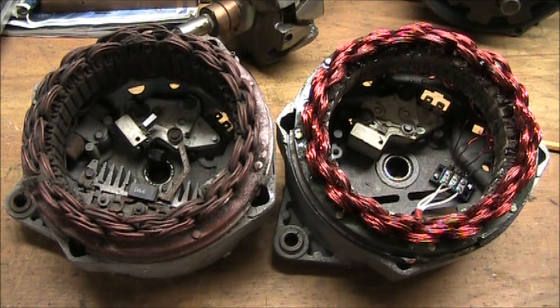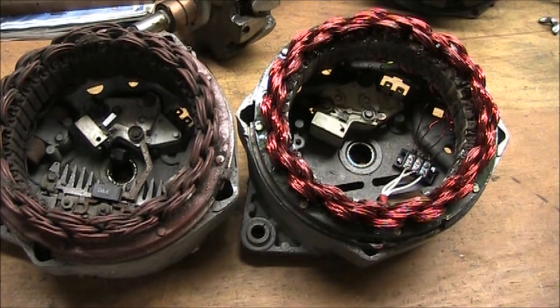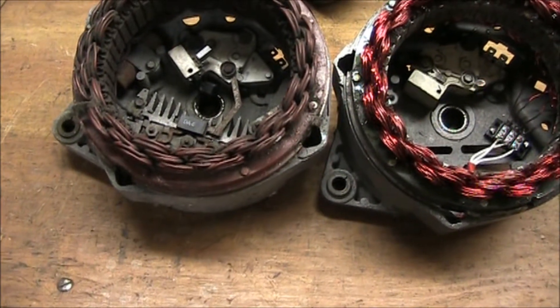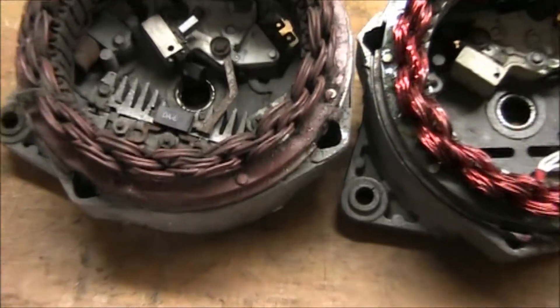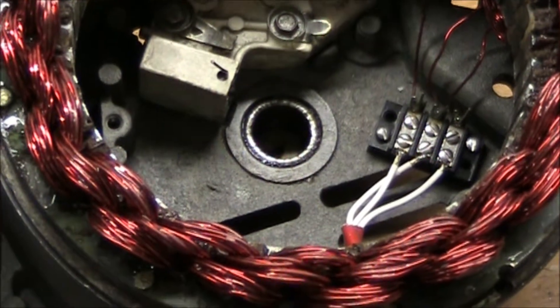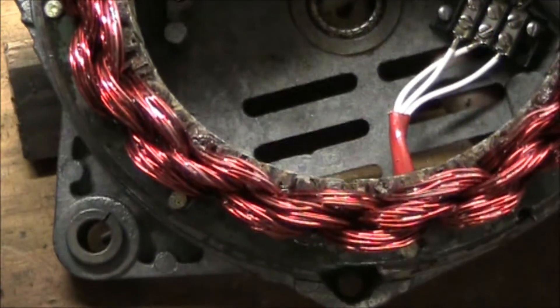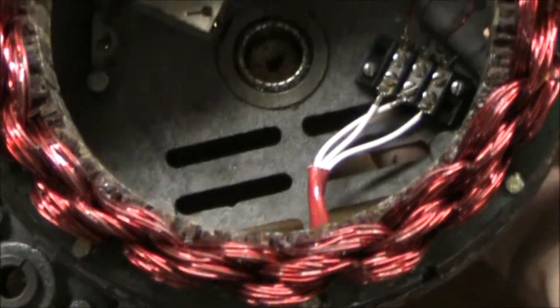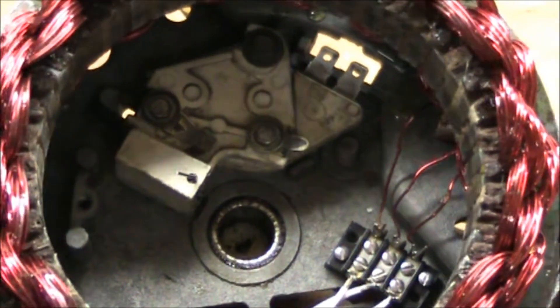What I have here is a 16-pole Delco Remy car alternator from a 1970s-era General Motors diesel-powered car. I rewound this to run at a higher voltage. There's a stock unit on the left here, and there's the rectifier assembly with its regulator. I had to remove that on the rewound unit because we're going to push it to several hundred volts, so I'm going to use an external rectifier and an external field power supply.